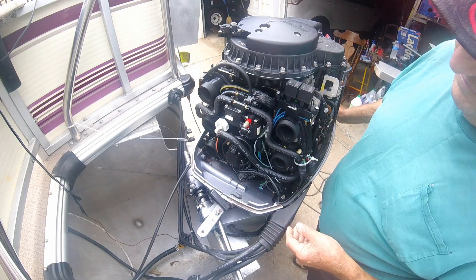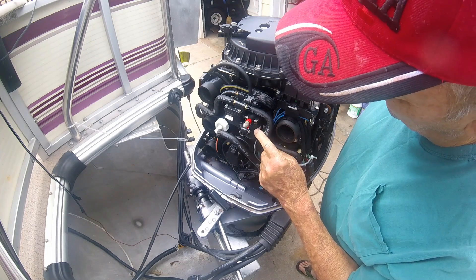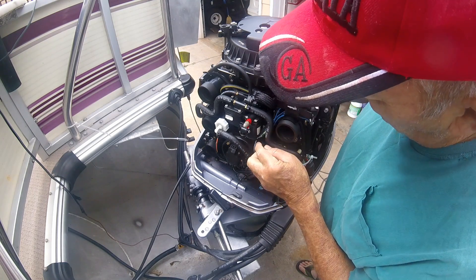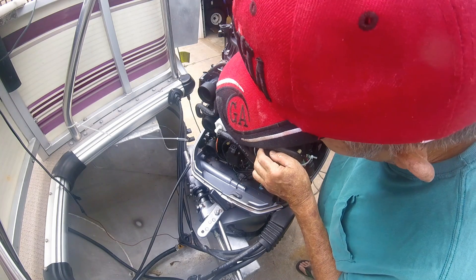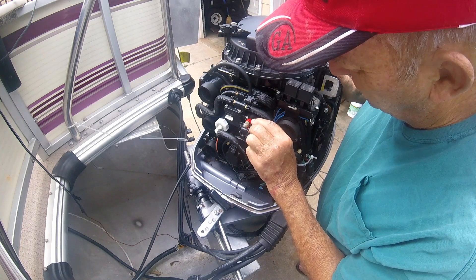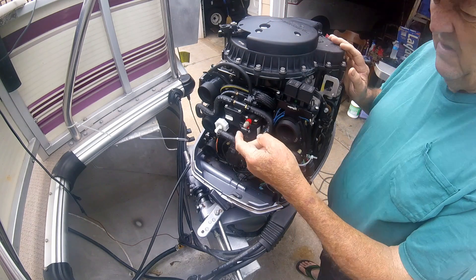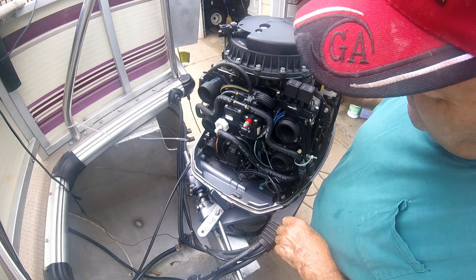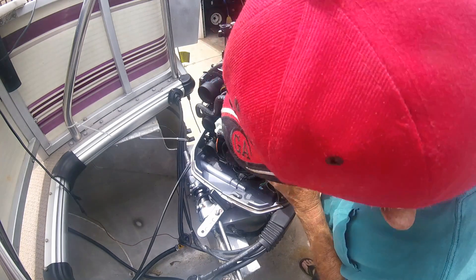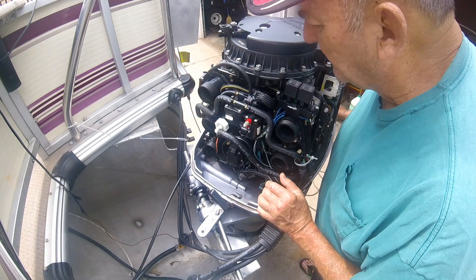What I'm going to try to do today — I've got to get to this portion right here. It's the primer solenoid; it's got a crack right here. But it's not engaging at all when I push the key in. I'm going to go ahead and take it off because I saw some gas leaking around it in this area when I had to turn this bypass open to start the engine. It looks like this carburetor has got to come off to get to it, because the screw in behind there is dang near impossible to get to.